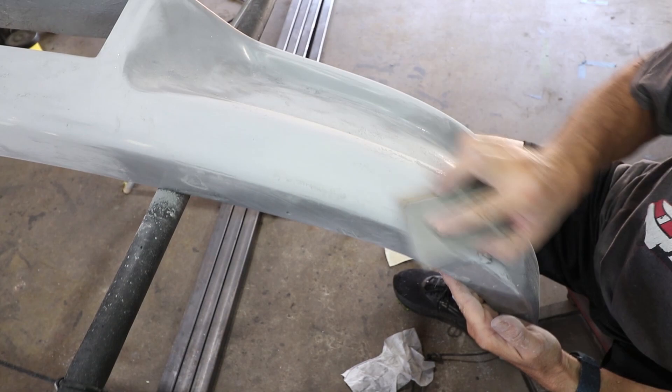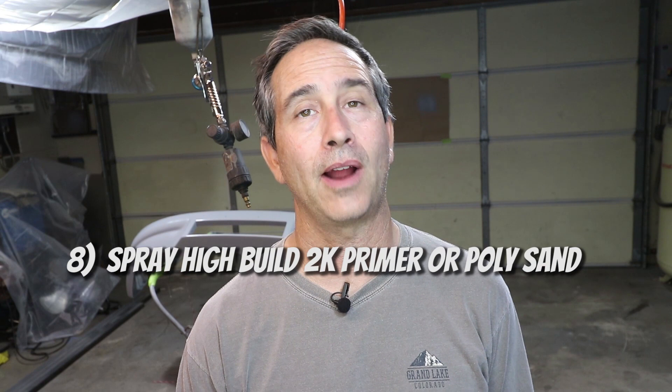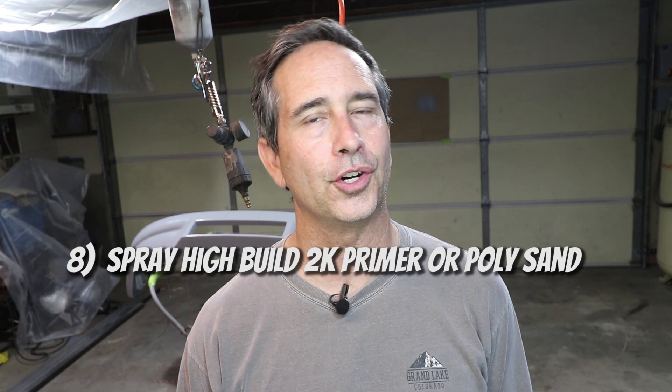Any areas that you broke through — whether it's bare metal showing or paint underneath showing — I like to do another spot prime with epoxy primer, make sure it's all the same color. Next up, if this is a door or something large, you could go with the 2K high build primer. That's really useful for evening out big waves in a panel like a hood. The epoxy primer is best as an adhesion promoter and corrosion inhibitor — it's a great product, but it's not super high build. So if you've got a lot of waviness, use 2K high build primer.